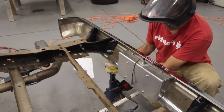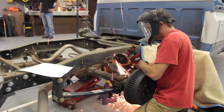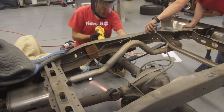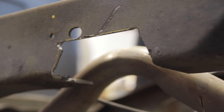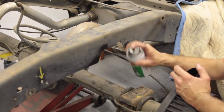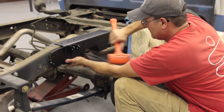There are a lot of different ways to cut out these C-notches, but in our case the cuts are pretty straight so I use a cut-off wheel — though a plasma cutter or die grinder would work also. Once the notch is cut out, I test fit it. Once I know it's good, I put a little paint on the edges to keep it from rusting. These C-notches fit tight, so it does take a little persuasion to get them into place.